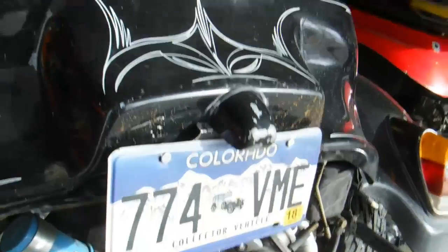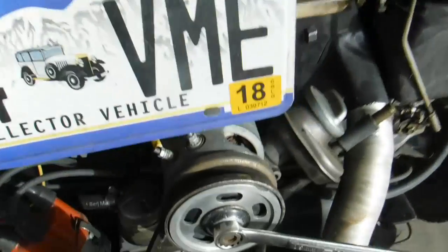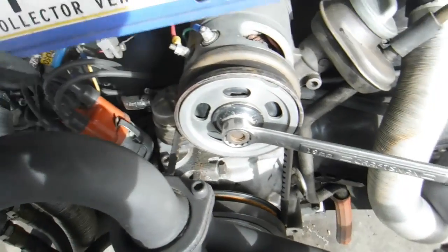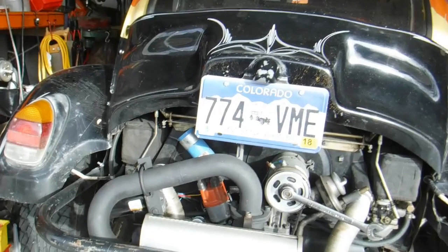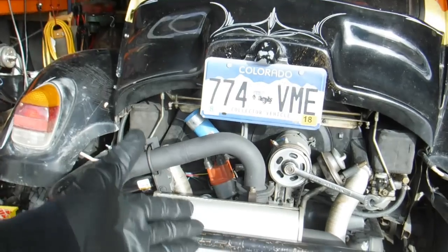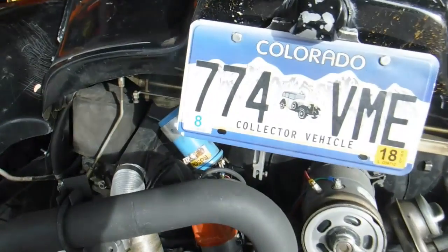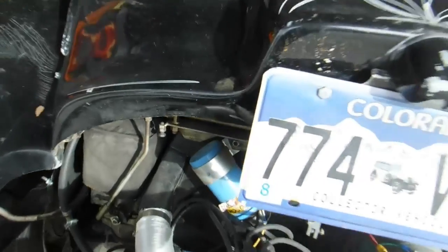What I did is leave the car in neutral with the emergency brake on, and brought the flywheel up to top dead center. I've got a little mark for top dead center and bottom dead center, and it really doesn't make any difference where you start from. I always pull the distributor cap off. Now you can see with this Baja exhaust it's kind of a real trick sometimes to see where the case halves are and where your marks are.